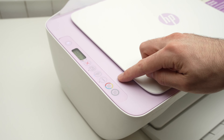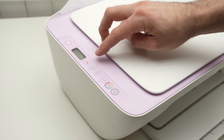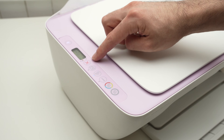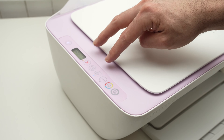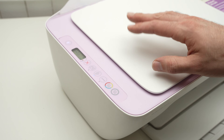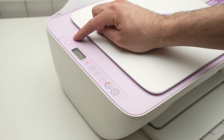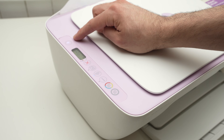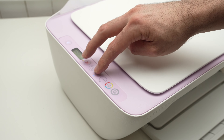If not, let me show you how to reset the Wi-Fi settings on the control panel. You need two fingers: press the X button and the Wi-Fi button at the same time for about 10 seconds. You'll know you can release when the power button stops blinking.